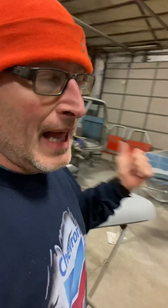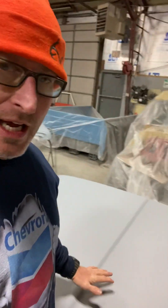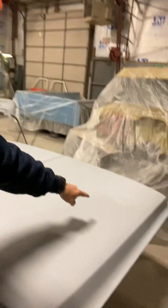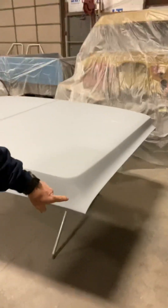We had some life bumps, dings, and dents that we were so close on but had to go back and fix. This was going to be painted for our last week of our red, white, and blue — this was going to be the end, here's our blue. But it just wasn't close enough. So we went back, re-scuffed, and got high build primer on here. Now as soon as we paint, we see a little dimple here and that. We're at 95%. So today we're going to block sand it all, and all the spots we had to fill in with bondo and stuff, you can see them — the little speck here, the little dent on the side. We scuff that again, prime it, and then we can do our final blocking and we're ready for our white sealer.